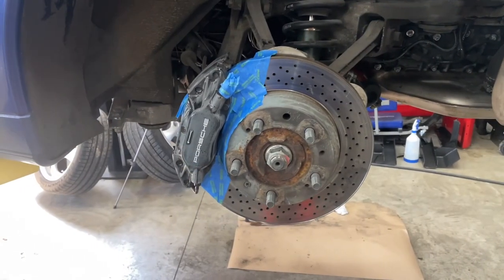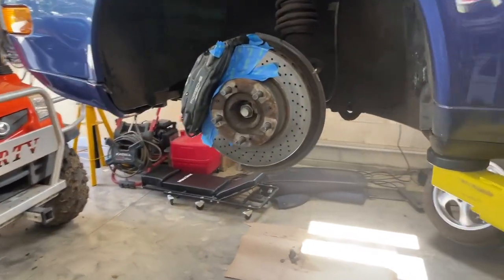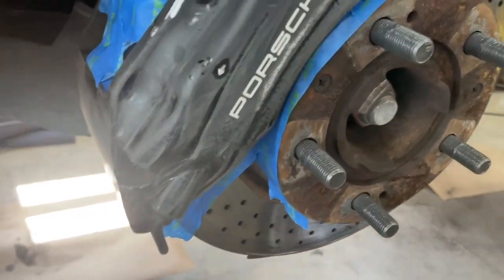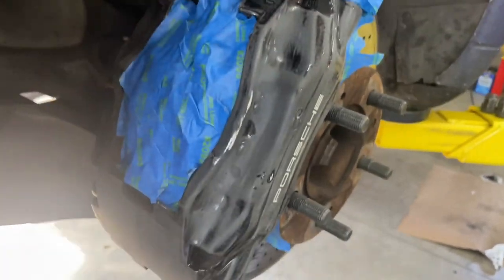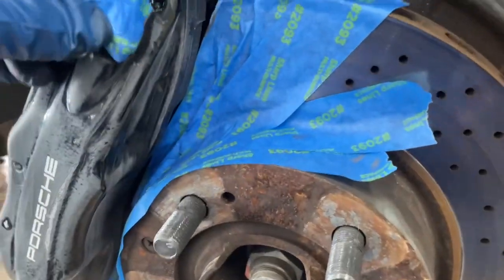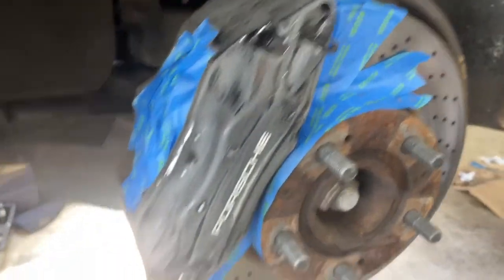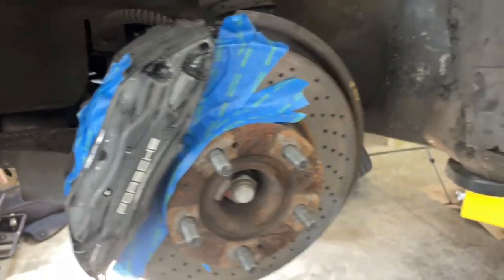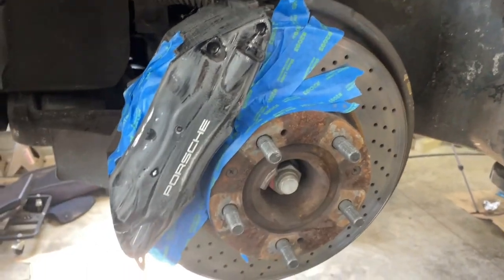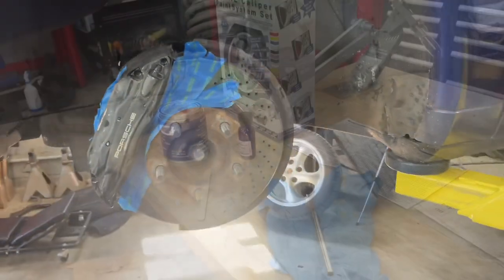I've gone through and repeated what I did on all four wheels — taped them off, buffed them up, degreased them when I pulled the pads out, and went all the way through and wiped them all down. The last piece was going through all the waxer and degreaser, and I've done that actually a couple of times. I keep running a clean paper towel over top to make sure there are no black smudges that still come off. Everything is nice and clean now — looks like we're ready for paint.